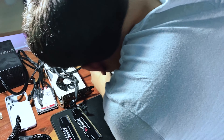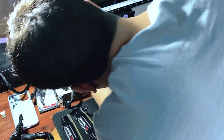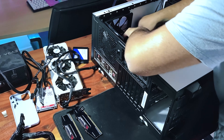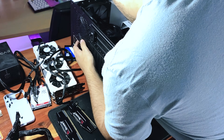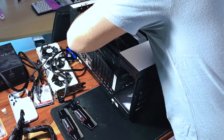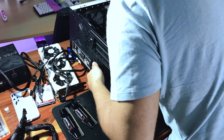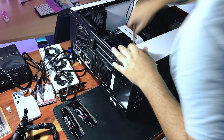We start by opening up the side panel. If it's tempered glass, put it someplace where it won't shatter. Place your motherboard IO shield inside the bracket — this sometimes might be tricky, but fit it in there. After this, place the motherboard on top of all the risers and try to wiggle the IO inside the shield.